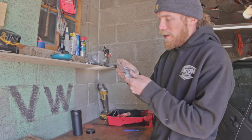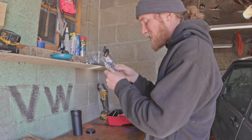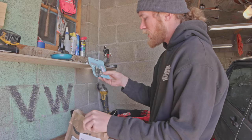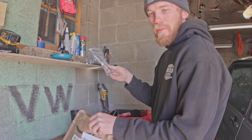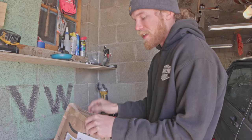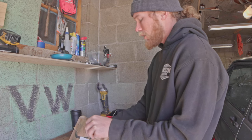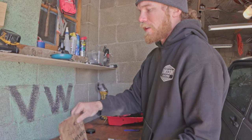Wow, that was fast — look at that, they're already here. Alright, it's like a few days later now. I ordered all these bushings, which we're about to try out for these spent ones. I also got in sensors for the rabbit — two pressure sensors to determine boost pressure and turbo drive pressure, a thermocouple for measuring intake temperature, and with intake temperature and pressure we'll be able to calculate intake density. And I have a couple potentiometers, and I'm going to use one of these, hopefully, to measure pedal position. With that combination, we'll be able to get some pretty nice turbo tuning going with the VNT.